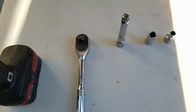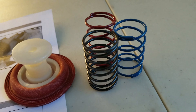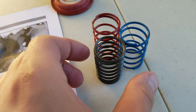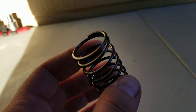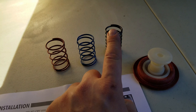This is the heavy duty compressor bypass valve — it's a replacement part. If you have a bad or failing CBV like I do, I would definitely recommend ordering this kit instead of just a regular replacement because it comes with a factory setting spring. This one is about 8 pounds, then they have a blue one around 12 pounds, and this one is somewhere around 14 or 15 pounds. Basically this one supports up to about 12 pounds of boost.